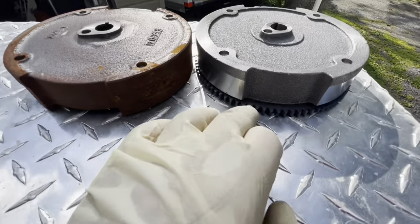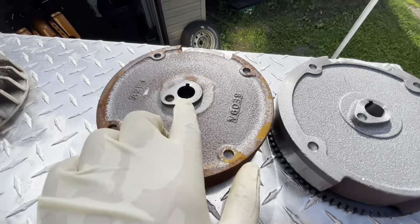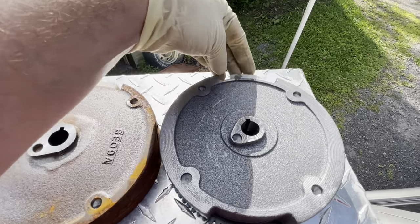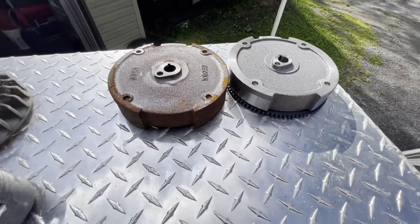The reason you've got to change this — this one's got the ring on there for the starter. Make sure the keyway and this is the same shape. This does like timing — it's all balanced, so make sure it's all facing the same way and looks the same.